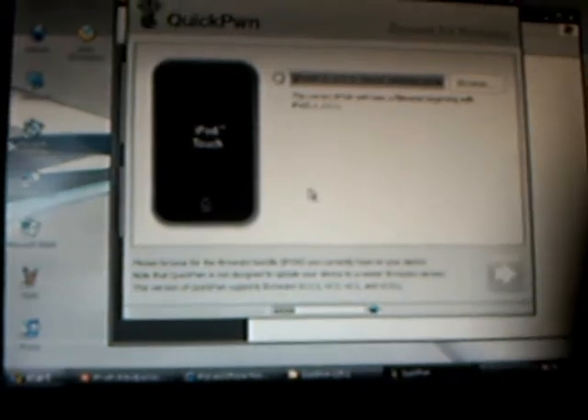This is probably tricky for some people. It's going to take you to this screen and it's going to locate the firmware. It's going to say the correct IPSW will have a file name with iPod, whatever it says. It should appear automatically, but if it does not, I have posted a download link to this firmware in the description. So go ahead and get that if it doesn't appear for you automatically. Or you can restore your iPod, but it's a lot easier just to get that and then browse for it. So once you have that, go ahead and click the next button.